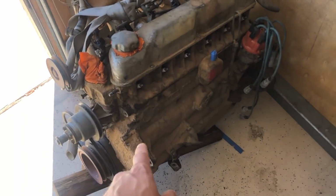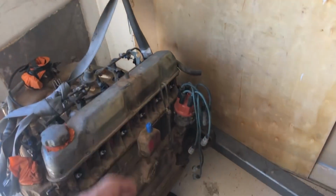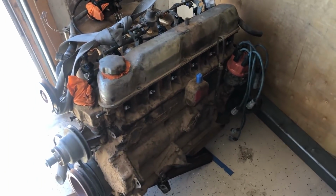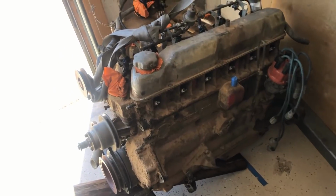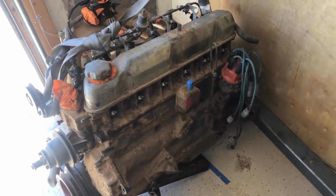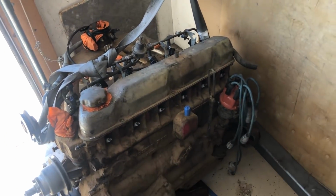Finances, you know. If it needs cam bearings, then I'm going to take this over and drop it in the back of the car here, send it off to the shop. If they're doing that, they're pulling the whole bottom end apart. So the crank's coming out, and if it doesn't need to be ground and re-bearinged, it'll just get re-bearinged after a polish.